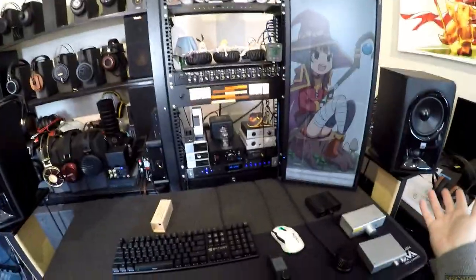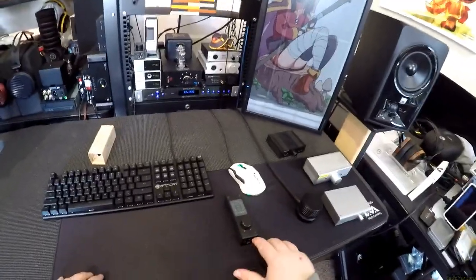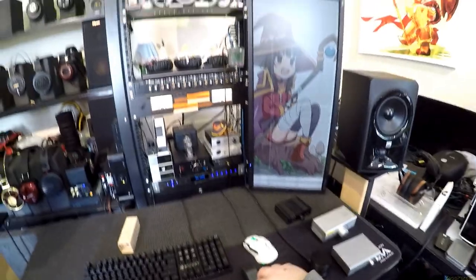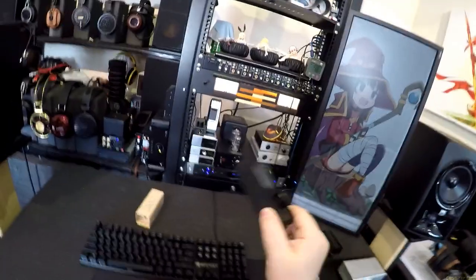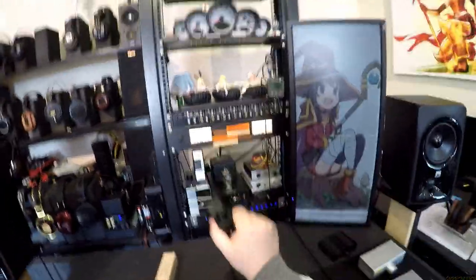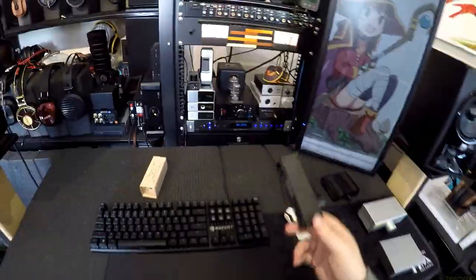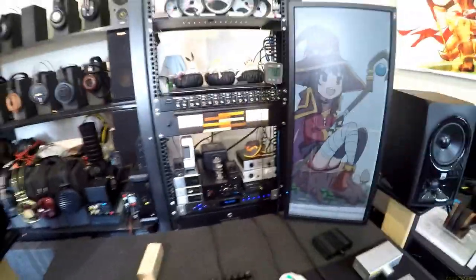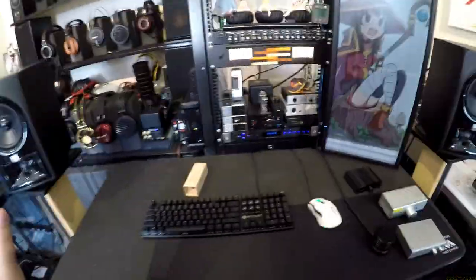And then your speakers are on and running, and whatever volume they're set to on the back, you go, I want to listen to speakers now. You don't unplug anything. You just switch it, you go, speakers. And now you're controlling the volume of your speakers through a good amp. I guarantee the G2 is better than any onboard sound card in a laptop, and most onboard sound cards in a computer motherboard, gaming or not, or whatever they claim. So that's $110. These are under $300, or these are under $400. That setup is as simple as you can get for I'm done.